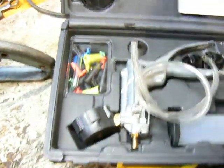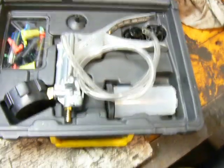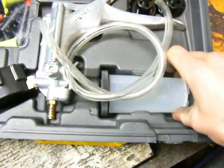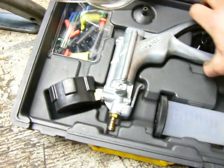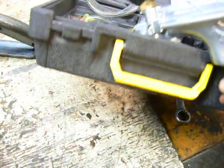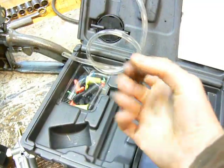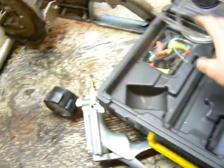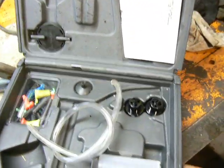In order to do that, I bought this handy unit. It's a MightyVac model MV8500 Silverline Elite Automotive Kit. You can use it to do some diagnostic checks on your engine, bleed your brakes — it comes with a reservoir to hold brake fluid. But I bought it because it's a vacuum and pressure pump all in one unit. Otherwise I would have had to buy a vacuum pump, a pressure bulb like what they use to check your blood pressure, and some tubing and gauges. It added up to about the same price as this. You can buy this new on Amazon for about $68 shipped.